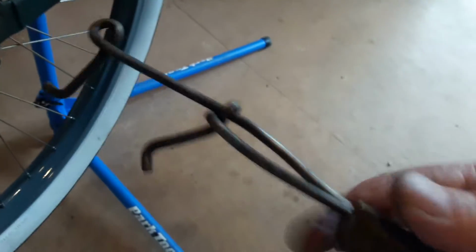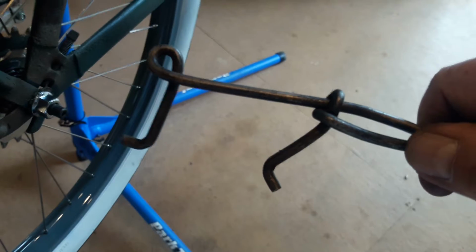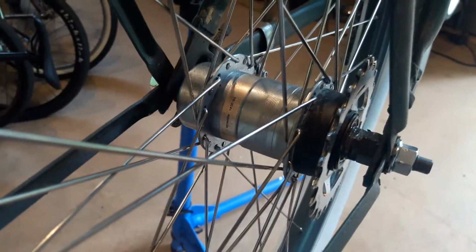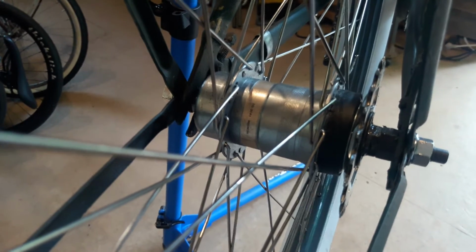But I had to spread the frame, as I typically do when you use these more modern hubs. And my old frame spreading tool that I got a few years ago, those hook in both sides of the frame, and then you pull this lever back. It's hard to do with one hand, but anyway, that pulls them spreading apart. It's bent, it's worn out, it's done. So it's going to hang on the wall from now on. So I had to figure out a different way to get this 130 millimeter spaced hub into that 110 spacing, which is dang near an inch, 20 millimeters.